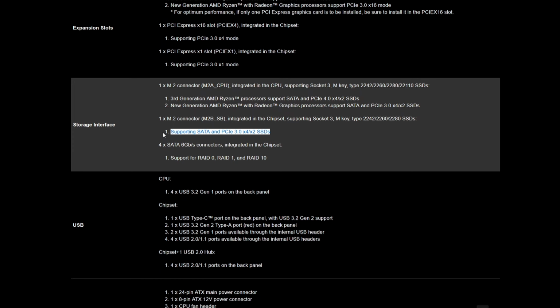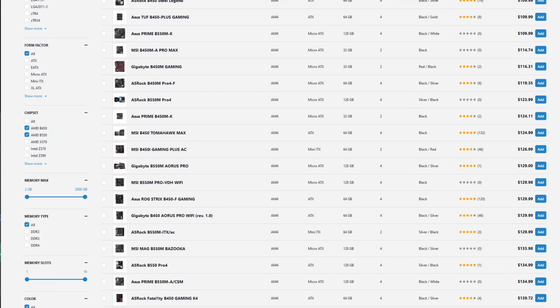In my opinion, if you're going with a 3rd gen Ryzen CPU or the upcoming 4th gen, getting a B550 board seems like a good idea. This one is cheaper than the B450 Tomahawk with an extra M.2 slot, superior VRM, and more USB ports. So it's a real shame it's not backwards compatible with previous Ryzen CPUs, but for most buyers it probably doesn't matter, because if you're buying this along with the new CPU, it's probably going to be a 3rd gen CPU.